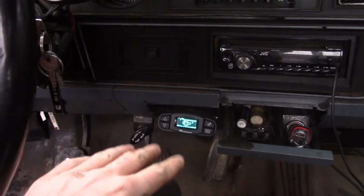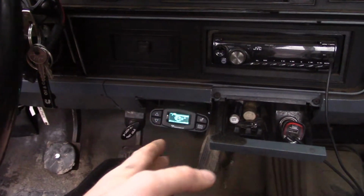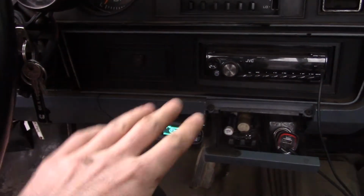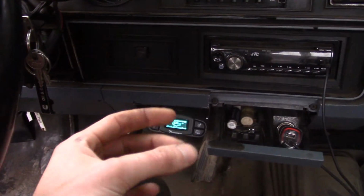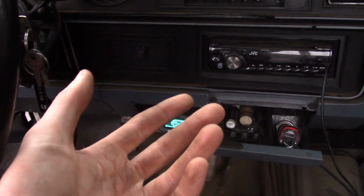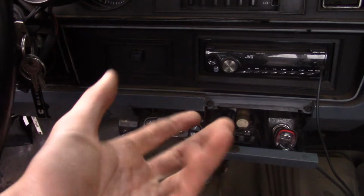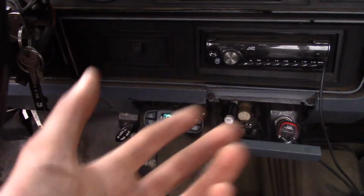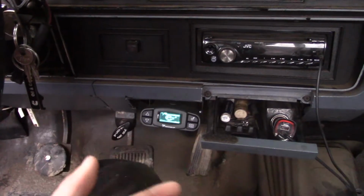Now, if you don't know much about these inertial proportional trailer brake controllers, the way they work, inside there's a little pendulum or a little... Basically, it's this. I think it's kind of the same thing as what's in your iPhone or something, so it can tell when you're angling it one way or the other. Anyway, it can sense deceleration.